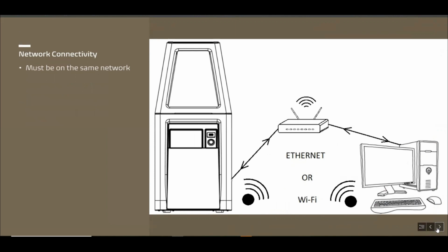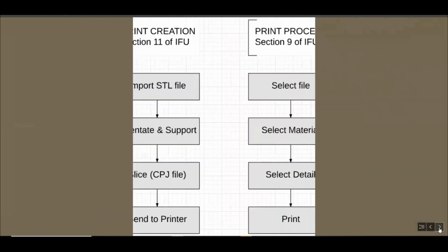How far away is the printer from your router? It's about as far away as it can be. Okay, well if it's over about 15, 20 feet, that's probably the issue. There's actually a Wi-Fi strength indication on the front main screen. I'll show you in a second what it looks like, but if you're very far away from your router, the whole printer is surrounded in metal, so that really attenuates that Wi-Fi signal. So even if you can get Wi-Fi with your PC, you may not get Wi-Fi using the printer just because of the attenuation of the metal on the printer.